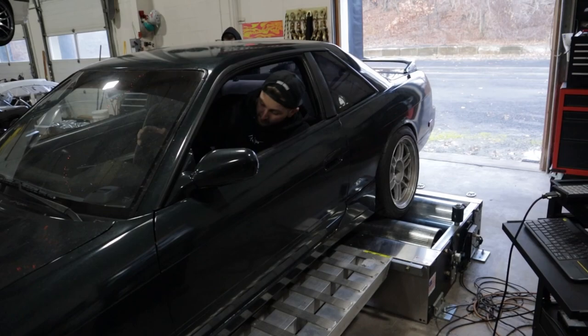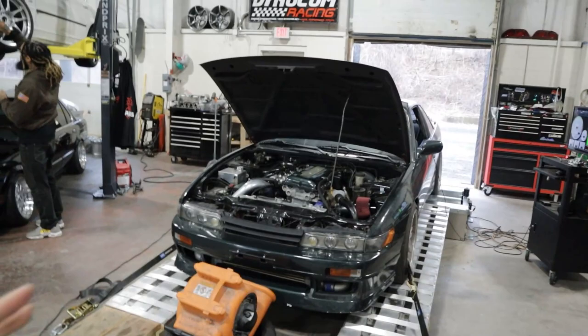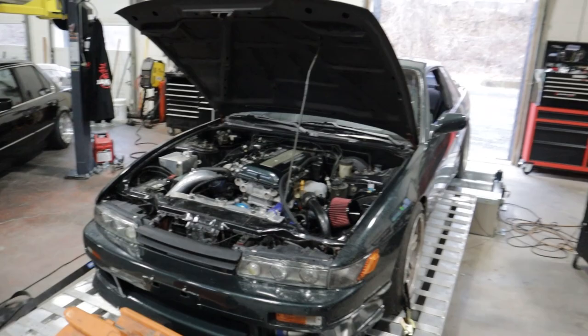All right Jimmy, what are we doing? We're going to do our first pull starting kind of from scratch. We'll do it on the wastegate — I'm assuming it's probably like 12 psi, we'll find out. We have fail-safes set up so if it goes into any realm that's not safe, it'll stop. We also found there's no IAT sensor on this, so we're going to add one of those later to dial things in. It's mind-boggling to me that there was no IAT sensor with the Link ECU, but they have a fuel pressure sensor.